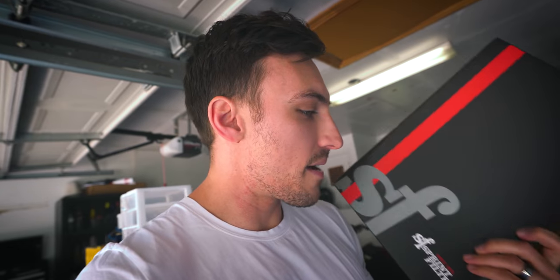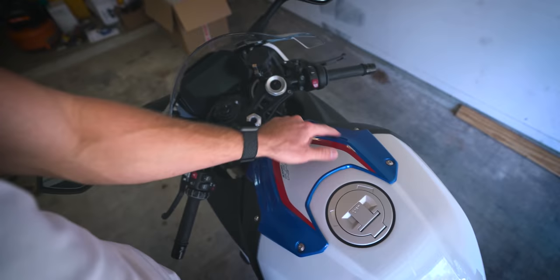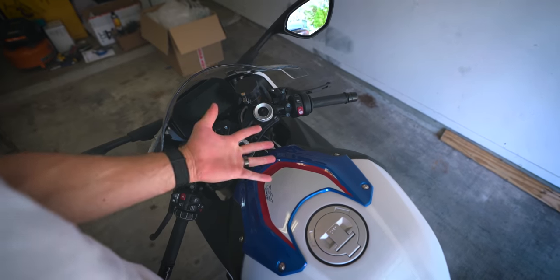You can check it out in the description, but this is actually a polyester filter rather than fabric that you'd see on most other air filters, which are soaked in oil. This doesn't have that. It's supposed to last like 5,000 miles before you have to clean it, and then you just rinse it off, let it dry, and put it back in. This is the P08 version that they have, which is more street-based than track-based, but still good for the track. All we gotta do is take the front tank cover off, then lift out the ECU, and drop in the filter. Obviously, take out the stock one. But get that put in, and then we can get the startup.